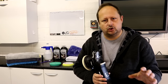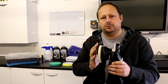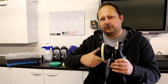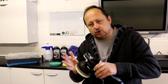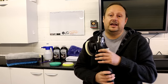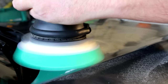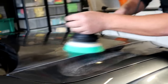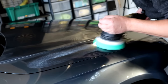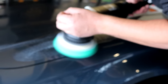The Mark I used to get a lot of criticism for stalling and bogging down — where the free-spinning pad rotation would slow or stop under pressure. Rupes addressed that by upping the power in the Mark II. This machine excelled on any flatter surfaces: the bonnet, the roof, flat door panels, rear quarter sections, rear bumpers — anywhere you can get the pad into flat, it works really well, and the correction is lovely. Using the tool is lovely.